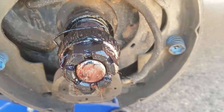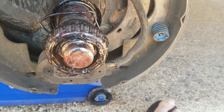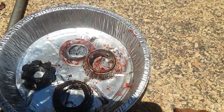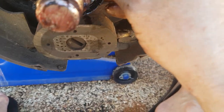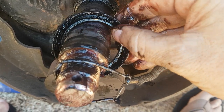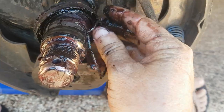Just a little bit of gentle coaching — go easy on it. Take the castle nut off and there's the inner bearing, identical to the outer. Make sure you separate them and keep track of which is inner and which is outer. The rear seal has come off, and inside it there's a rubber seal with a little spring — and as you can see, that one's a little bit worse for wear, so we'll replace it.